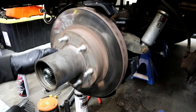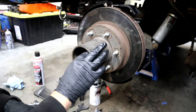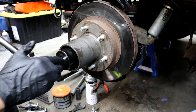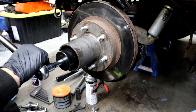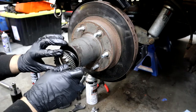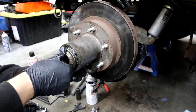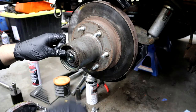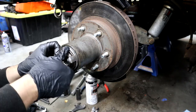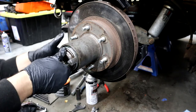After that the lock ring goes on — make sure you align the tab with the groove on the inner axle shaft and make sure the nipple actually goes in one of the holes. Next, use the outer spindle nut — the one without the nipple — torque ranges vary from about 75 to 200 foot-pounds, so somewhere in there; I did mine at 100. Next I put in the spring cup — again I'm not sure which way this goes — then put the spring in, put the hub gears assembly in there, got it centered, and spin the hub to get the splines lined up. You can put it all in as one assembly. The very outer piece, when you push that in, will hold everything in place and you can tap it in nicely — I used a dead blow hammer just to get it started.